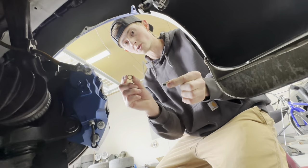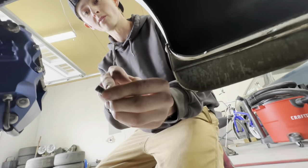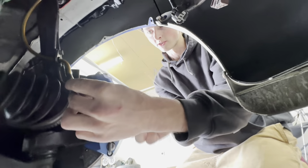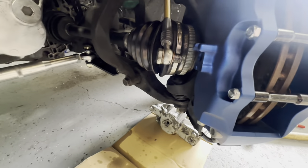With this 14mm banjo bolt, you've got to make sure you have a copper crush washer on it. These are brand-new crush washers from the 5-lug installation. There's going to be a copper crush washer up against the outside of the brake line, and another copper crush washer up against the inside of the brake line to seal the caliper itself — one there and one there. Just go ahead and thread that in by hand.